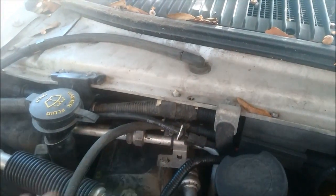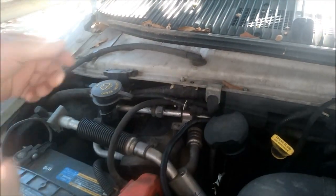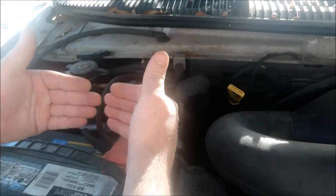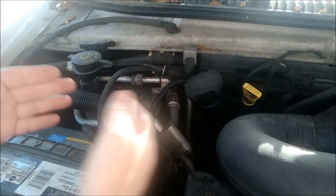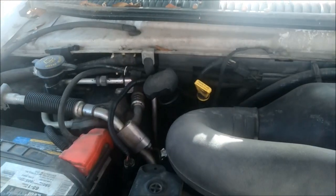And you can get in there, and you pretty much got to be good with your hands and be like a surgeon and get it all in there. And then once you're done, you make them meet in the middle, and you hold them together while the weatherstrip adhesive dries. And once that's done, you got a gasket again without removing all of this stuff, because that's a nightmare.